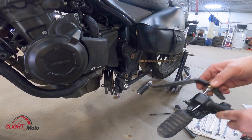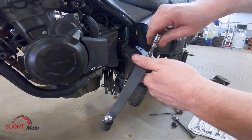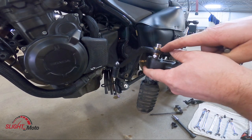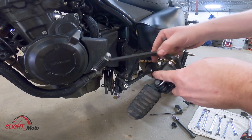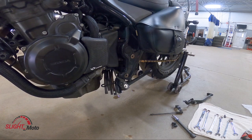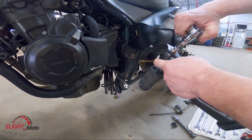The shifter goes up top. Then we're going to tighten it. They do have these special washers — there's like a bearing inside and each washer has like a collar. So when they're tight it can still move quite easily. You should always put some blue Loctite on these.